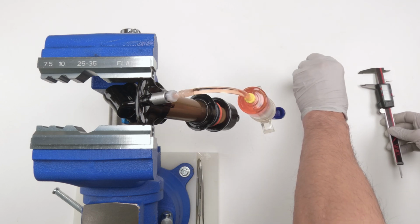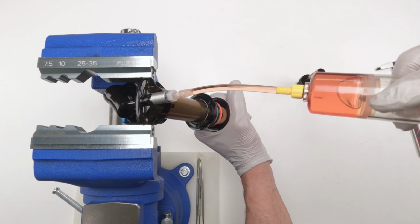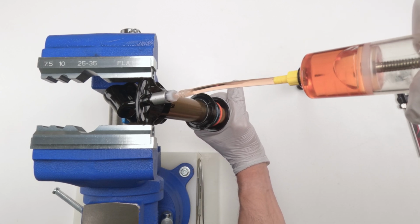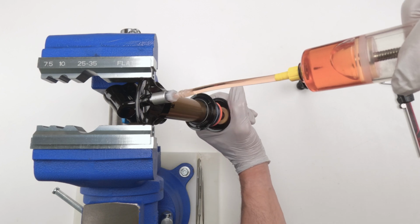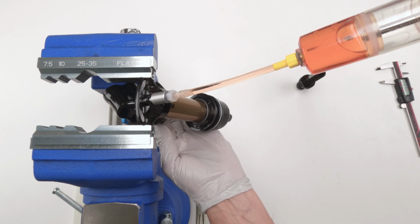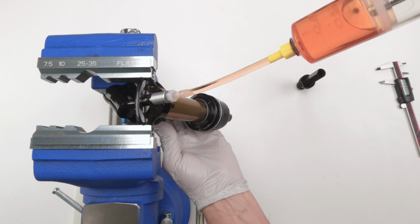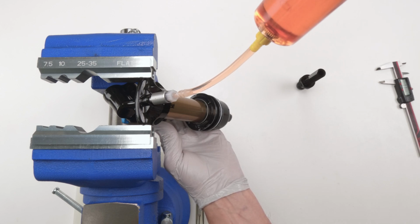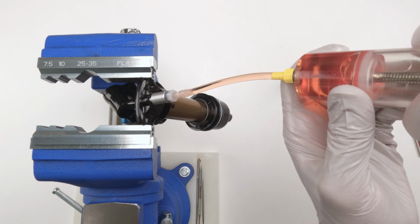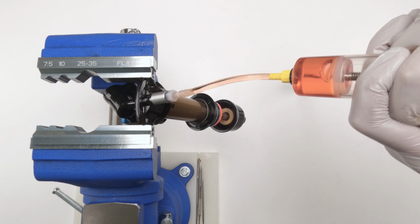So before we set the IFP, let's give it one more round of tests to make sure that we have no air inside, right? Wow, that's silent. Again, let's push this up. Let's suck up the IFP. Make sure no, oh, there you go. One little bubble, and that's why we test it. All right. He's all the way at the top. Let's push him all back out. Let's do that about 10 times. One more time before we set the IFP.